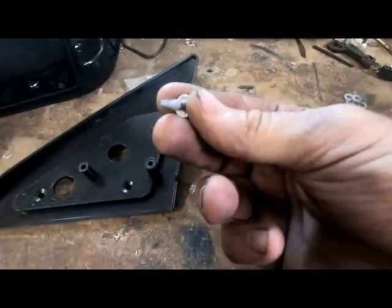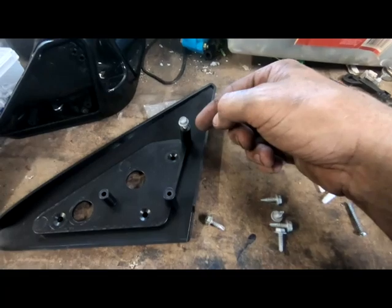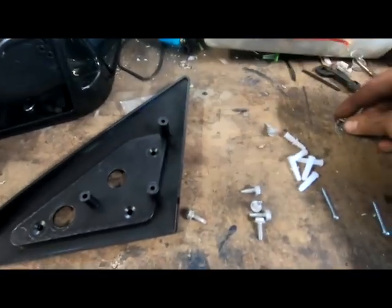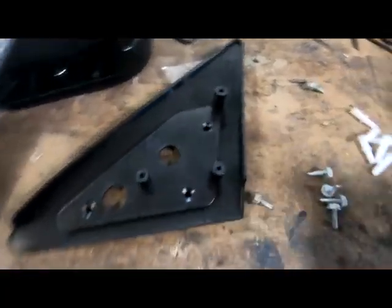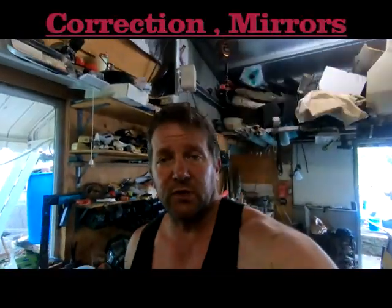And these little self-tapping metal screws will actually fit in there quite nice, as long as that depth is okay when it's in the door. We are going to put washers on these ones to go through here, because we want as much grab on this area as we can, because the mirror's hanging will fit outside. So at least we've got a solution for that for now.